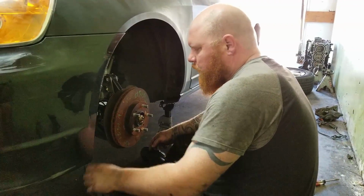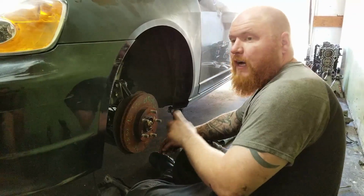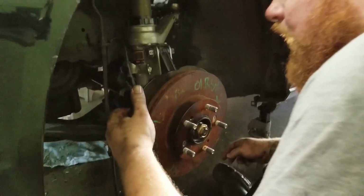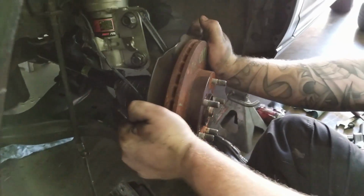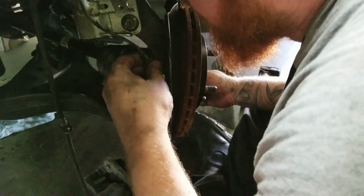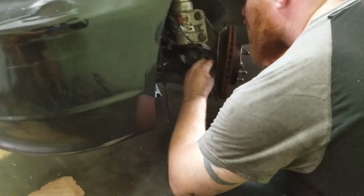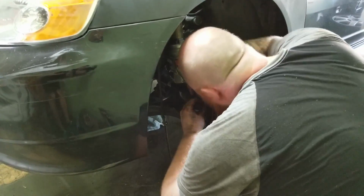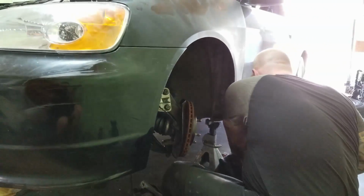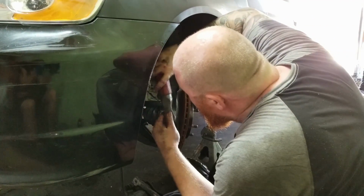All right, so finally, with a lot of persuasion, a little bit of lube, finally got it, axle fits. And then back here, which you can't really see too well, right here, ABS sensor corresponds with the ring right here. And if I look at the gap, it's perfect. So with these knuckles, it fits, which is a good thing because they actually have two different spacing for the base model and the Type S. So sure enough, it fits. So I'm happy with that.